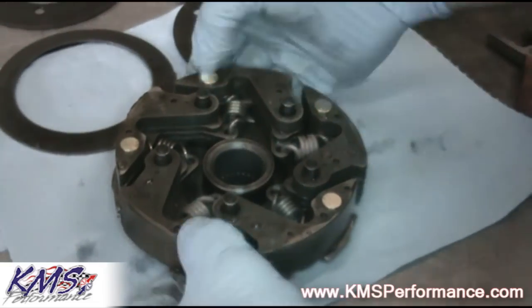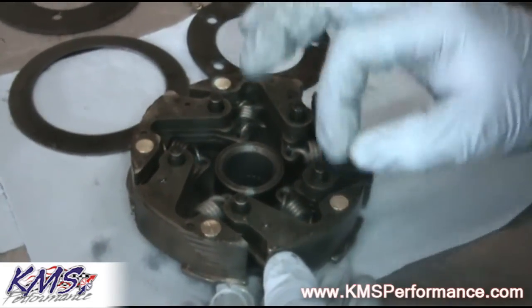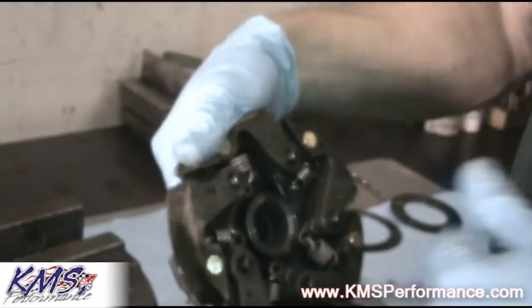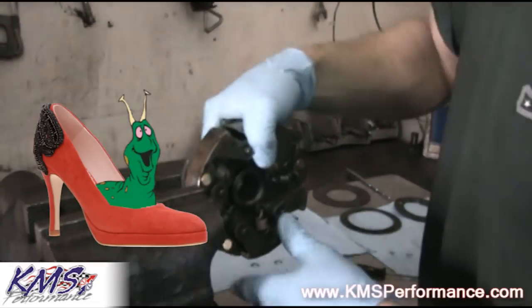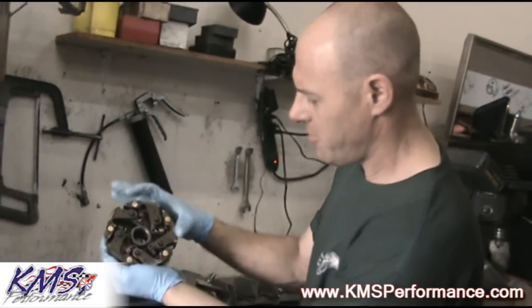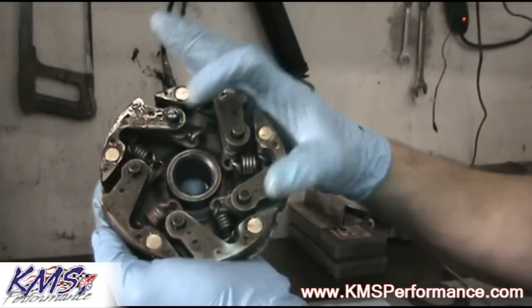Go ahead and put the smaller side in. If they're a little stubborn, you can go back over to the vise and lightly press them in just a little bit. Finish securing the slugs and make sure they're all the way nice and deep into the shoes. That's the finished assembly. Now we're ready to go ahead and put on the base plate, the spring plate, the retainer plate, and the E-clips.